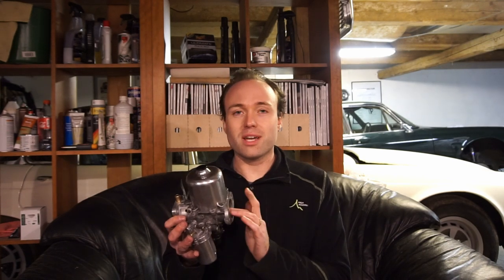There is one more thing I need to do before I can put them back on the car and tune them — and yes, there will be a video on how to tune an SU carburetor coming soon — but before that we have to try the drop test. If you have multiple SU carburetors that have been apart before, these things are 40, 50, maybe 60 years old, someone may have put the wrong dashpot back or the wrong piston in the wrong dashpot. The piston and dashpot are finely machined and they go together as a pair.